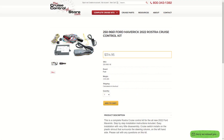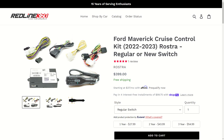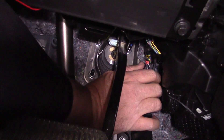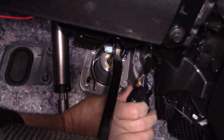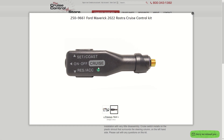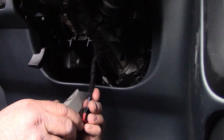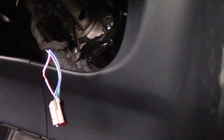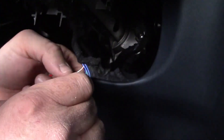Many people will be apprehensive about removing the steering wheel airbag, so it's worth mentioning that there are aftermarket cruise control options available for the Ford Maverick. However, the aftermarket unit does not interact with your dash, meaning the set speed may be inaccurate — it locks the engine at a desired RPM and releases it when you tap the brakes. You also get an ugly stick added to the left side of your steering column. In my opinion, the aftermarket option is actually more intrusive to the vehicle's electronics than activating the function already built into the system by Ford.